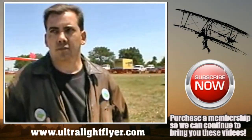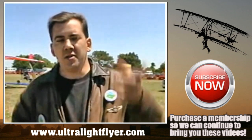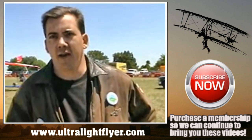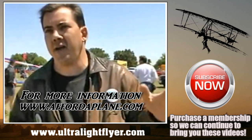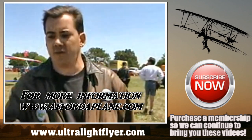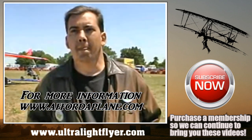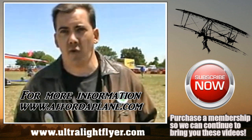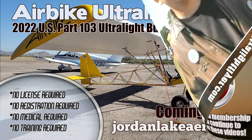The airplane has a 277 on it now — are you planning to offer other engine options? Yes. A lot of people will likely use a Kawasaki 440, which is fairly inexpensive and can come off Phantoms. They bolt right on and are a good weight. Anything up to about 85-90 pounds doesn't affect CG, so you can use a variety of engines: 447, 377, engines still in production. For more information, the designer is Dave Edwards and you can visit affordaplane.com to see everything, order plans, and connect with other builders.